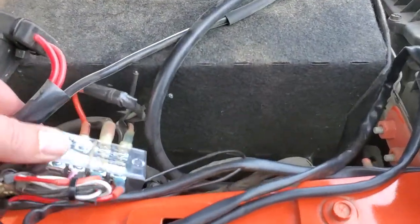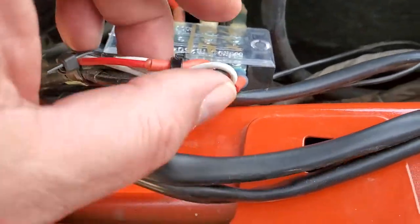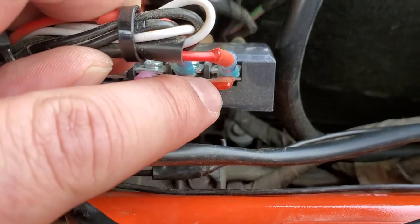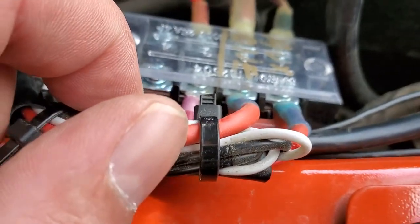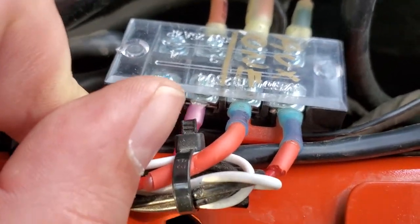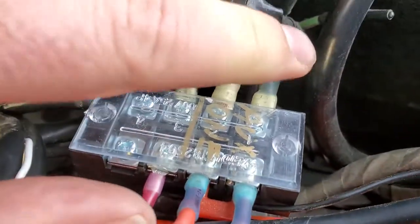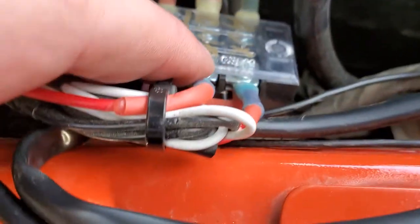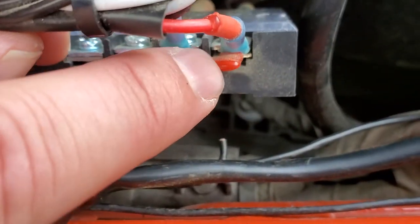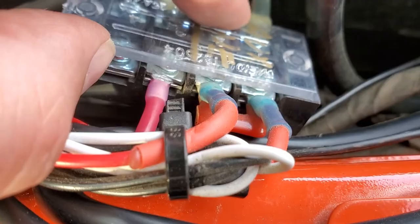What I did is I went to Amazon — I'll put a link in the description — and got one of these terminal blocks. These terminal blocks come with bus bars. The bus bars cover all four terminals, but I cut that one down. The kit was really cheap, and I think it had like three or four of these blocks in it. I have power from Aux 1, the 40 amp power, coming in here to this terminal, and I bridge the power over to the second terminal. So Aux 1 feeds all three of these connections.